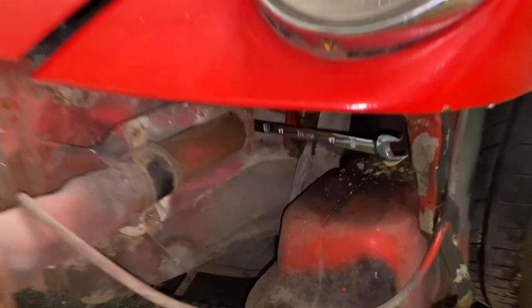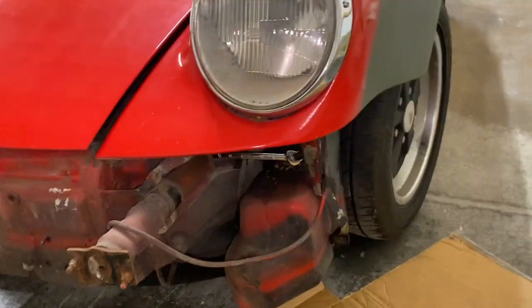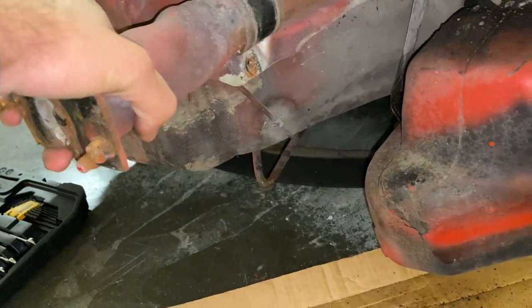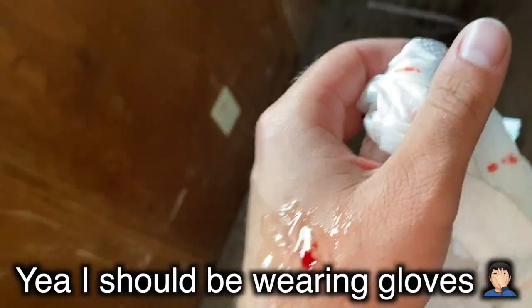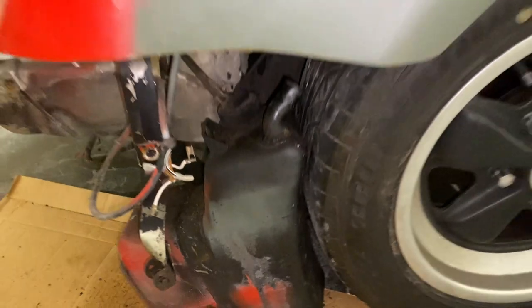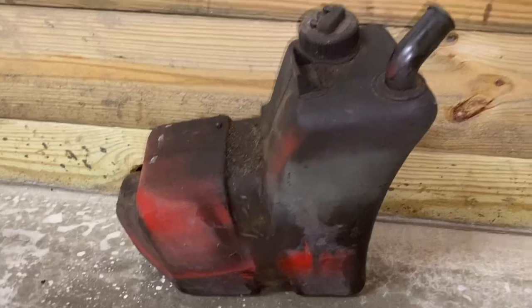I might delete this tank. The next step is removing that 13 millimeter bolt - this is going to come right off, and then we're going to be able to refit the front bumper and see exactly how much finessing we're going to have to do. Got the clamp off and I sliced myself in the hand. Going to unscrew that cap, remove the tank, and be able to refit the bumper. The tank is off - it had some fluid in there, which is insane.